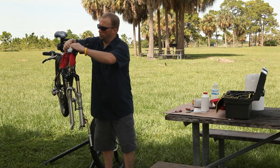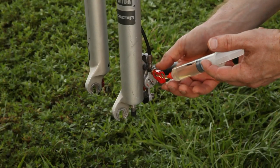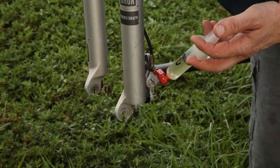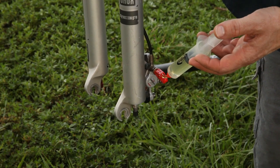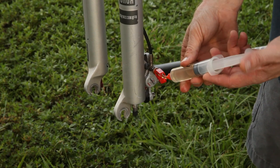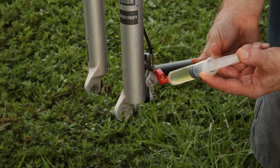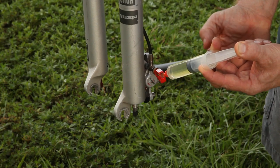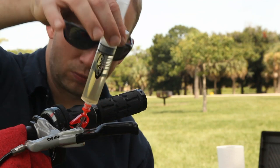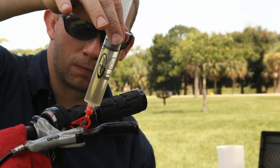Undo the little stop on each syringe, and now you're ready to bleed. What you're going to do is squeeze that syringe, making sure that the bubble is on top — you don't want any air going into the system. This is the whole reason we're bleeding: to remove air from the system. As I push, this is going to move a corresponding amount, and you'll see if there's any air in the system. You'll also see the older, dirtier fluid coming out.